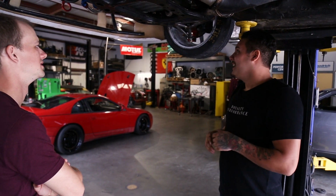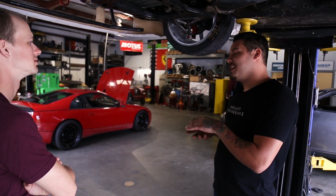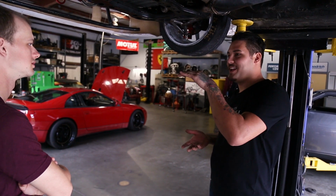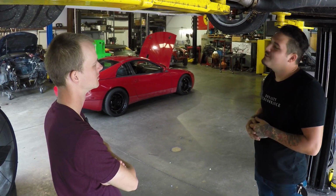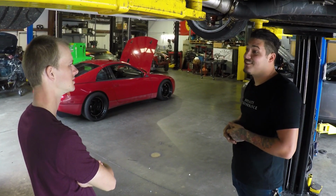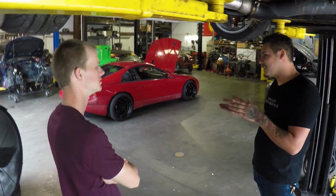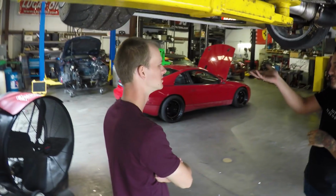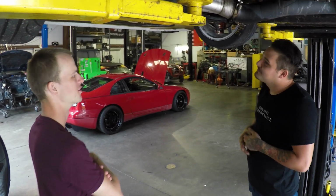Like I said, the big difference with the V8 versus the rotary is its taller weight. It's not that there's more, it's actually taller, which is something I've noticed a little bit different in the chassis. That's a unique thing for people considering V8 swaps in it. Your weight is just a little bit taller, like throwing around a taller stick or trying to balance a broom on your hand. Right. So, are you a rotary fan?